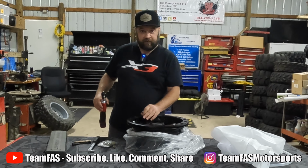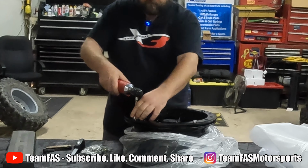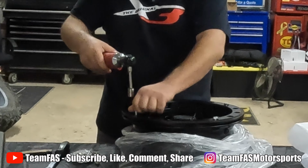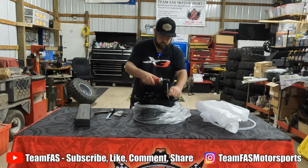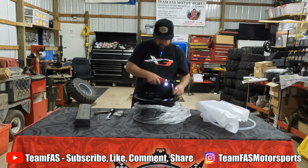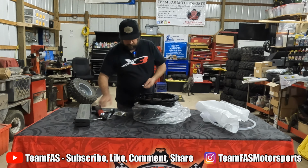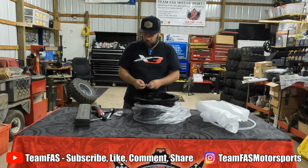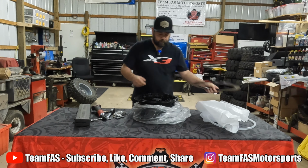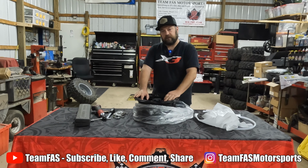All right, so on these are 1/2 inch. So you just need your 1/2 inch socket. Okay, so these 4 bolts are your starter bolts. They are longer, so that will help you seat the ring once the tire's on. So you remove your ring. Now, before we get set up on this one, we'll go over to the tire machine. I'll show you guys how to dismount the tire from the other beadlock, and then we'll swap it over to this one. So show you guys quickly.